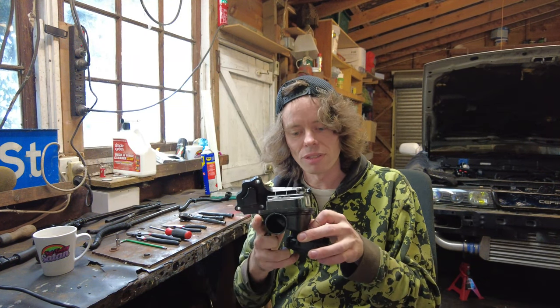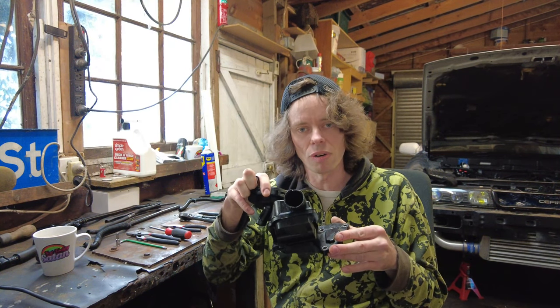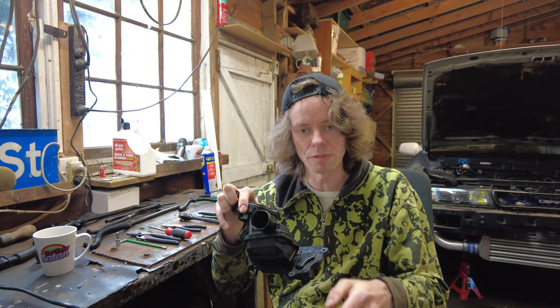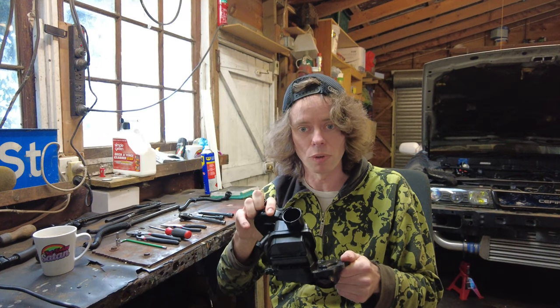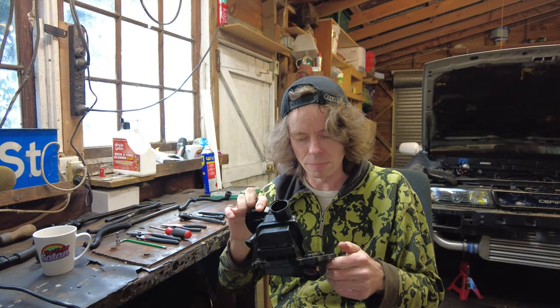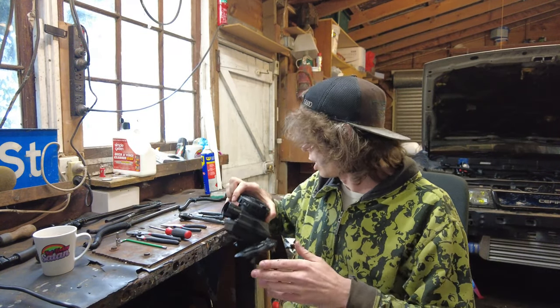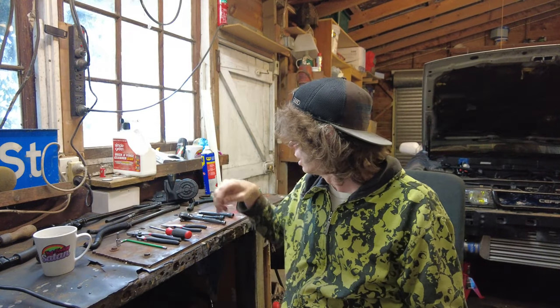As you can see, the break there is on the gasket. This actually sits on the cam cover on the left bank, if you're looking at the vehicle from the front. So that would be the right-hand side bank for a right-hand drive car. Whatever, it's on the left when you're looking at the front. Brilliant. I didn't know that was broken, but anyway, you have to take it off to carry on, to take off the throttle bodies and then take off the manifold.